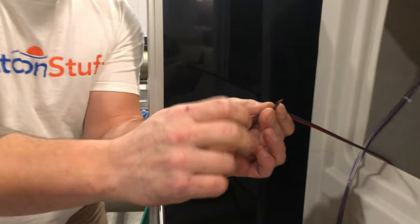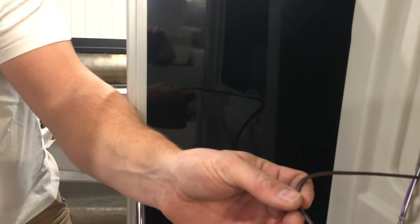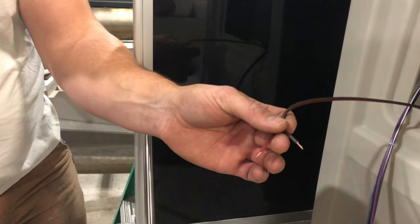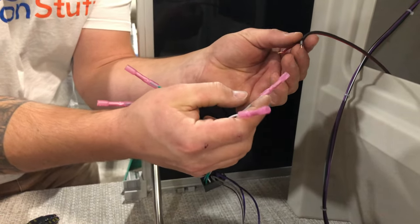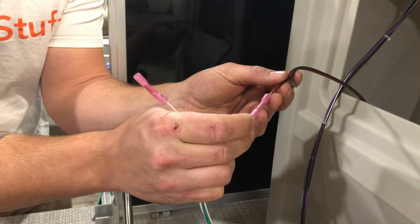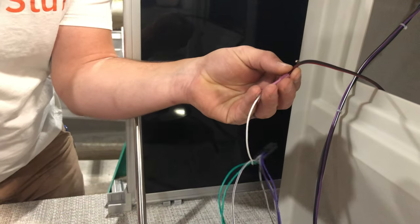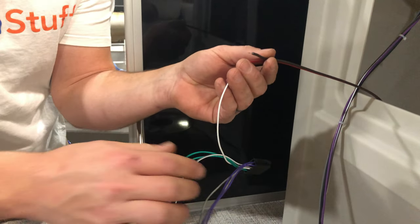So this is my front left speaker. I just have to look at which wire front left is — it's white and black. Then all I need to do, once I've peeled these back and have my wire ready, my positive red wire is going to go to the wire with no stripe. I can put that in and crimp it down.